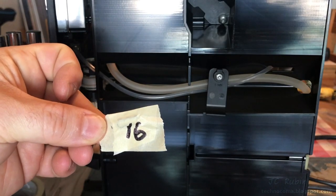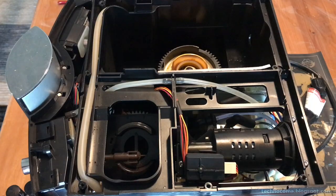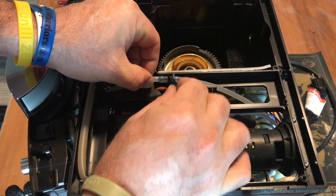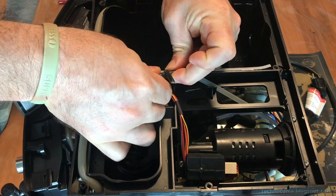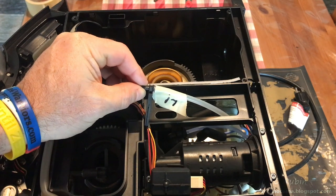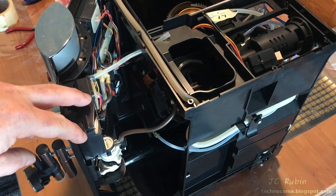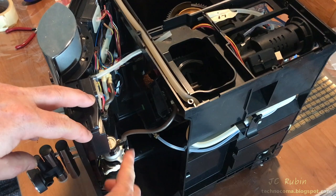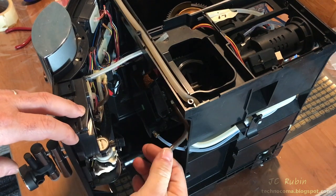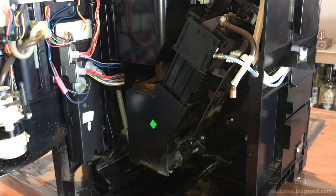With the clip removed, that hose can be pulled right out of the socket. Now we see a top hose with a T fitting in the middle — this T fitting can be lifted off, and the forward hose gently pulled out of the T fitting. I've labeled this disconnection as seventeen and snapped the fitting back into place. The cover moves out a little further, leaving one more hose — give it a couple of twists back and forth to loosen it and disconnect it right off the valve. I've annotated this connection as eighteen. At this point the front door can be completely opened for service.